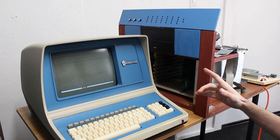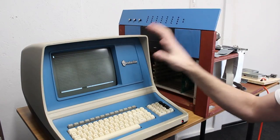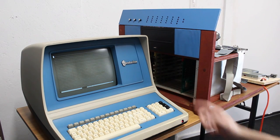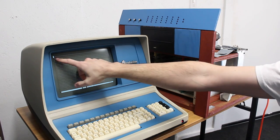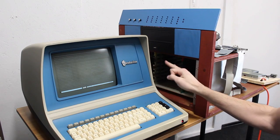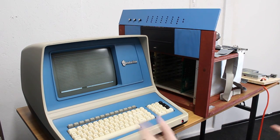Okay, we're hitting the moment of truth — this is genuinely the first power-on test. I'm just looking for a 'D=' prompt on the terminal here. The terminal is on and flashing 'fail,' which tells me it failed some self-test, but it still functions as a dumb terminal and that's all we care about. I've confirmed this terminal and the cable I made work by plugging them into the genuine system and getting a 'D=' prompt, so if we have a failure it's not on this part. To get a 'D=' prompt, we need a working CPU 6 card, a working MUX card, and a working memory card.